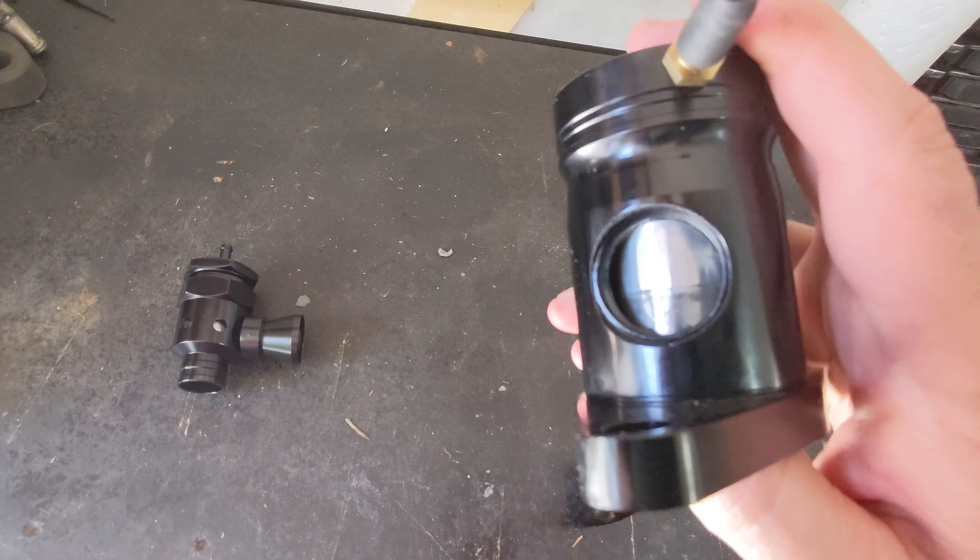The whistler has been removed. Now this is just going to be the regular blow-off sound with the whistle removed — same stretch of road, trying to hit the exact same PSI. Obviously it'll be a little bit of a sound difference. So here we go. That's your normal blow-off valve sound. Looking at the boost gauge, it doesn't look like it's leaking anything — the PSI would normally be about the same anyway. Car felt about the same.